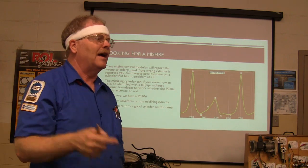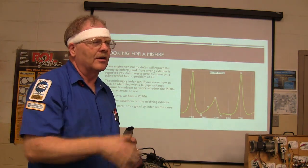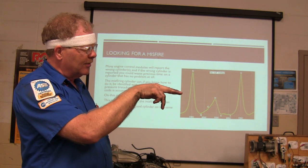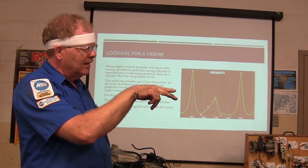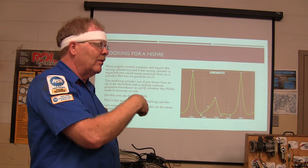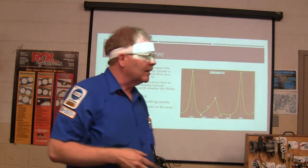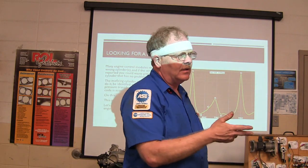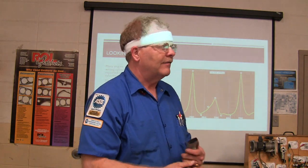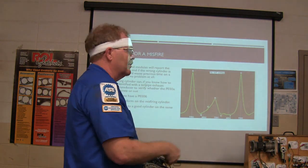What we're trying to do is surgically figure out what we're going to do to repair this thing. What was the first cylinder we were getting a report on? Seven and eight. Well, before that we got six. And now they're just moving all over the place. He's discovered on that one, doing injector flow testing, that some of the injectors aren't squirting any fuel at all — five and seven are doing nothing. Still checking on the others; the jury's still out on six and eight.